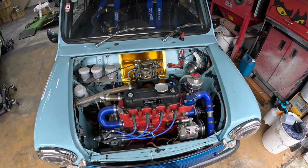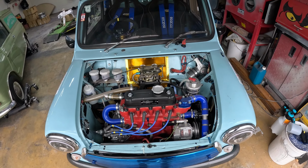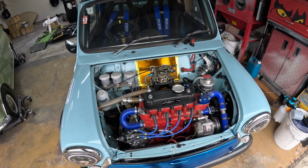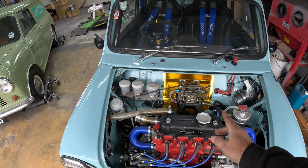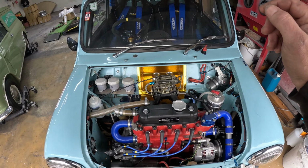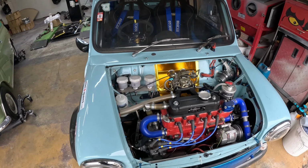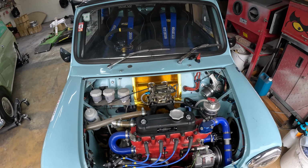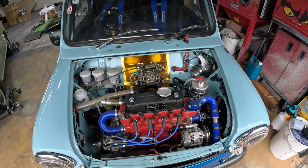we had a little bit of a blip at Goodwood. This was after COVID, so that was 2020. As we were going round, it didn't seem right. It lost a bit of power, and I think when I'd gone round one of the corners, I'd probably dropped down a gear, and the revs weren't right, and so the, what are they called? The push rods. One of the push rods. Trying to think of the terminology. Sorry. It rebounded, and it wasn't anything catastrophic. But they stripped the engine down to see what the problem was, and that's what the problem was. It was one of the push rods.